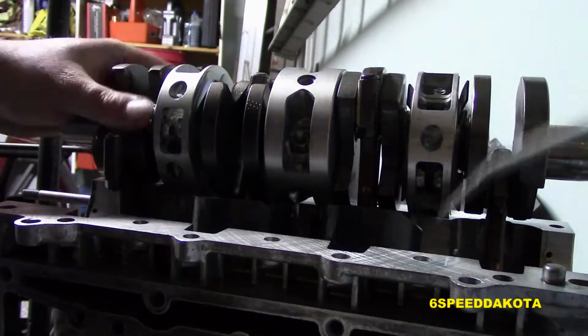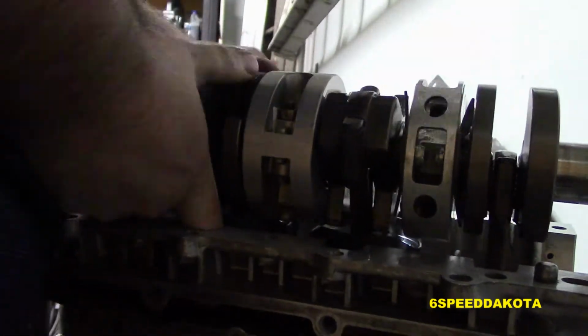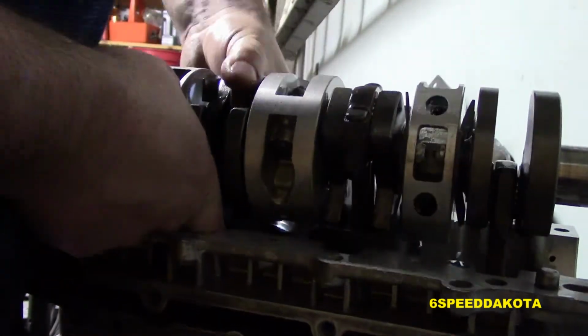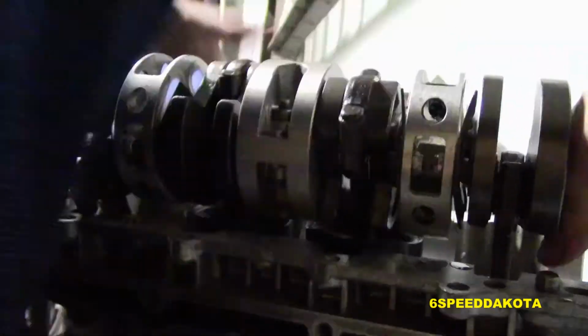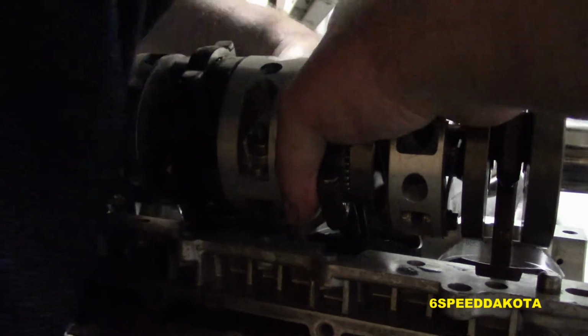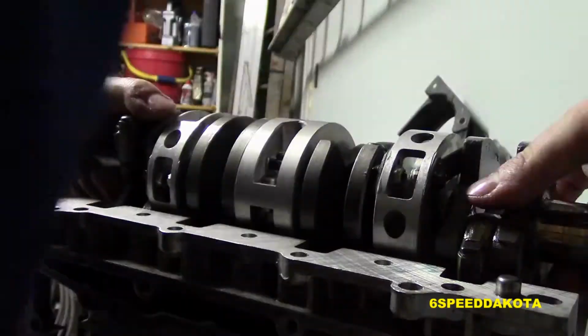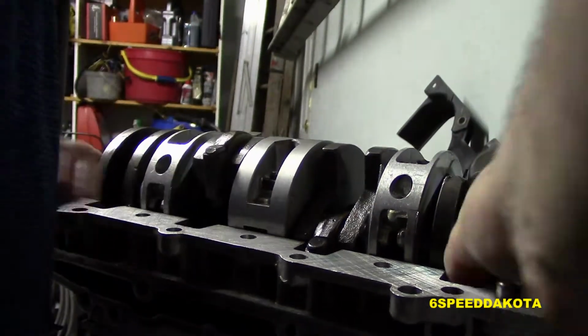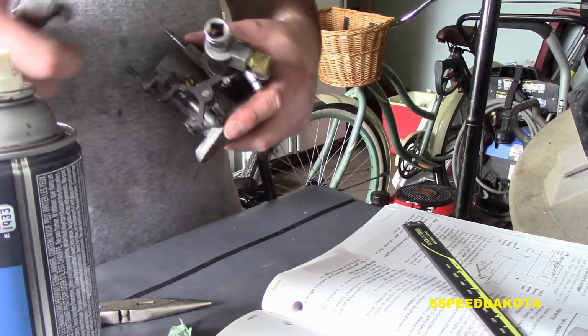Now we're dropping the entire crankshaft assembly in, putting a couple shots of oil in it. The dowel pins are installed in the block. This is a little tricky. There is a special tool for this, like I said, but apparently those tend to break piston rings, so just massaging them in by hand apparently is the best way to do it. It's a little tricky, but I ended up doing it. I can't imagine what a 6-cylinder is like, so that might be a little bit more tricky. Because there's no head, you can't feed this in from the front.